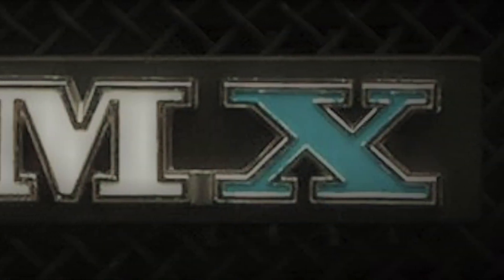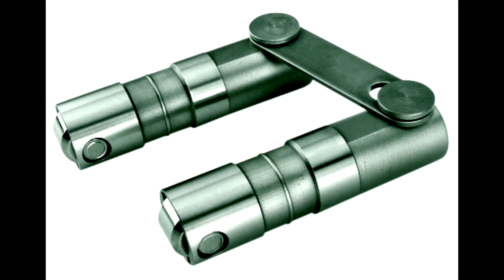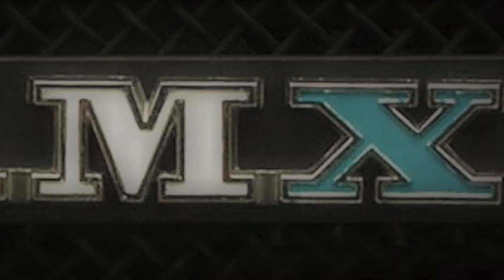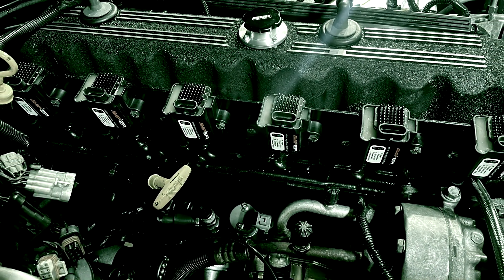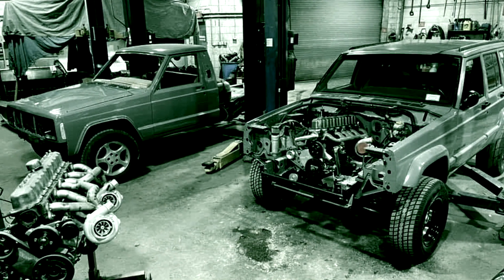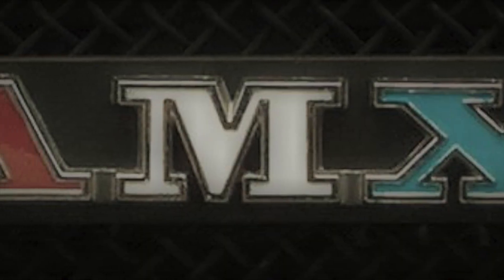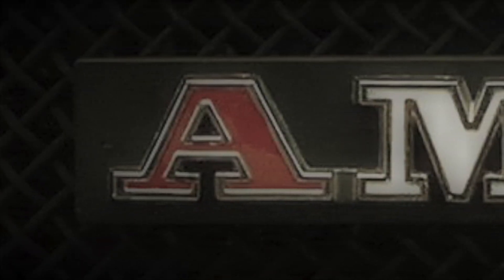I've modeled the 58mm throttle body on a stock 4-liter — it runs in stock eliminator, stock automatic. The index is 14.05 and these are running 12.79. With a 58mm throttle body, and that truck weighs 3,300 pounds. A short-bed Comanche 92 weighs about 2,700 pounds soaking wet. So do you think 58 is big enough? It depends on what you're doing. That's a stock-flowing head — but it's a 92 head with a valve job, NHRA specs. I had one port flow 230 cfm. That's pretty good for a stock valve and everything.